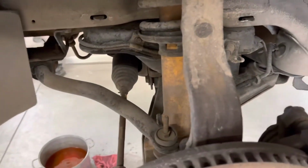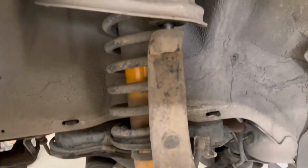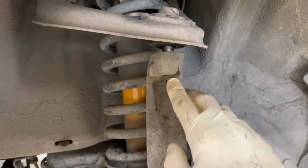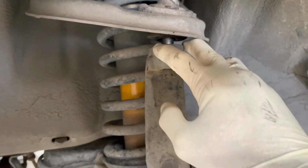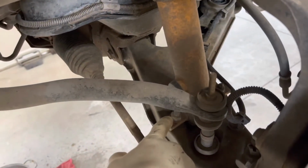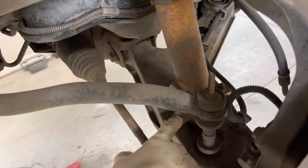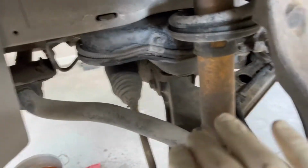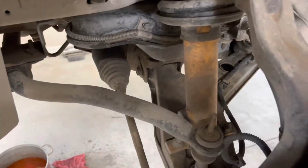And since I'm doing a cradle drop, the suspension components that have to be undone, which I've already started here, but I did want to show you, is upper ball joints, knock those loose. The strut from the lower control arm, you want to undo that. And then I undo the sway bar here on both sides. Again, this is both sides. I'm only going to show one side, but just so you know, this is both sides.